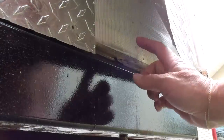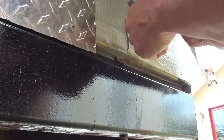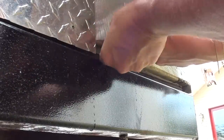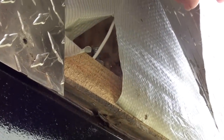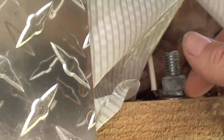I'm doing this kind of blind — I'm actually looking at the camera monitor to see what I'm doing. Not only is this a bizarre angle, I can't see what I'm actually doing and the monitor is showing it backwards. So there's the bolt, and there's no lock washer or anything on there. This wire is just pinched between two flat washers here. So you have to get a wrench on here so you can get a socket on the bottom of the frame, or a wrench, however you're going to do it, and spin this bolt out. What I'm doing is I'm putting a ring terminal on this wire instead.